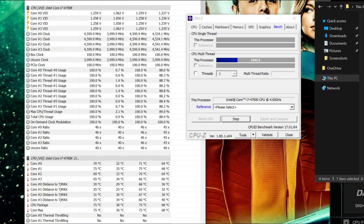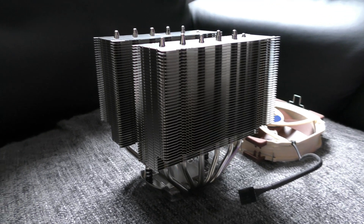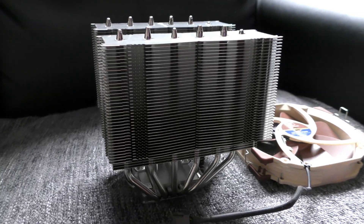Now we are running all cores at 4.6 gigahertz and we've been stressing it out for quite a while — the max temperature there is 75 degrees, with readings of 70, 75, 69 and 65 on all of the cores. So we're actually running at a higher clock speed yet lower temperatures than with the lesser cooler. Overall, I think that's a massive success and I thoroughly recommend the Noctua CPU coolers.